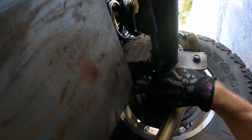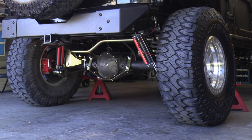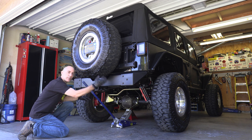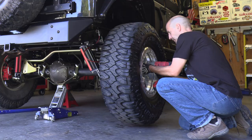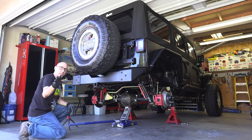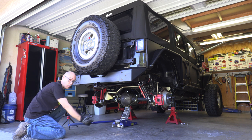You don't actually have to take your wheels off to do this, but I'll show you how to disconnect each of these things at the wheels so you'll have a better idea. Let's get started. I have a couple of jack stands under the frame rails — normally I'd put them under the rear axle, but we're going to let it droop, so I have them precautionarily under the frame rails. I have the front tires chalked so they're not going to go anywhere. We'll just buzz the rear tires off and gently let it down onto the jack stands, letting the suspension droop all the way out.